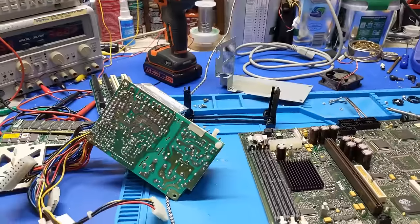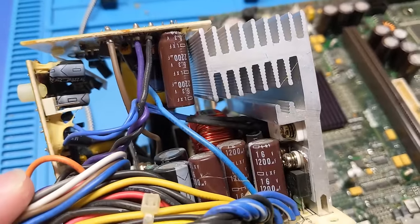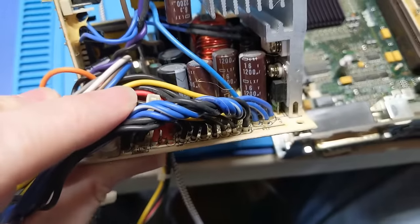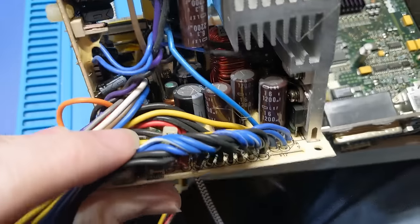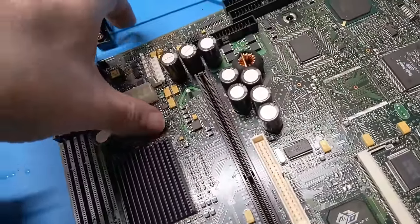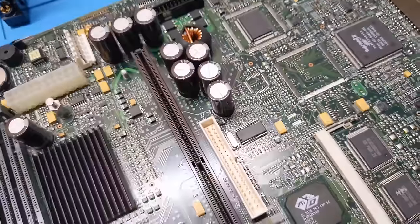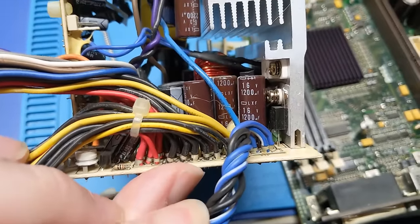Also, while these are drying off, a friend of mine just informed me that the LXF series, United Chemi-Con, Nippon Chemi-Con, is a known bad series. So that means I'm going to have to take this apart and replace them anyways. Well, I mean, if we want to improve the reliability of this thing, we need to do that. I do want to check these, though. Are these the same LXF series? No, they're not. This is the PL series. So, okay. We know at least those have to be changed, so...